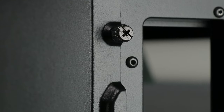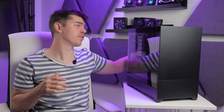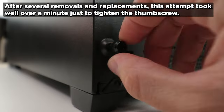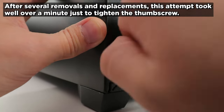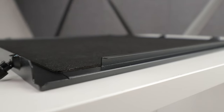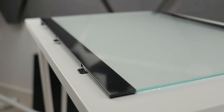Getting inside is easy — not a lot to complain about. I'm still not a fan of the retained thumbscrews, but these ones aren't very offensive and seem to work most of the time without much fuss. After removing and replacing all these panels a good few times, the steel side panel's lower thumbscrew — I think the retained thumbscrew has gotten a little too used to pulling into the retain section, so it's just not functioning the way a normal screw would. Once unscrewed, the steel side panel doesn't fall away uncontrollably but instead rests on a linear angle built into the lower section — there's no way it's going to fall off and take a chunk out of your desk. The same effect goes for the glass side panel, achieved with hooks and slots rather than that linear angle. Perfect marks for accessibility.